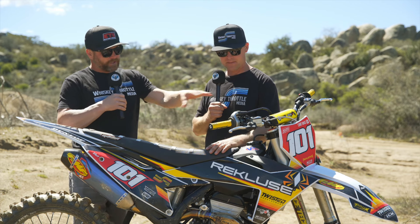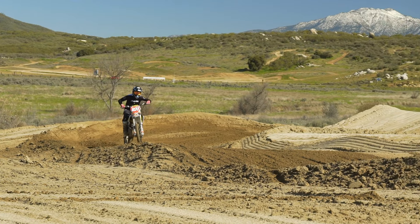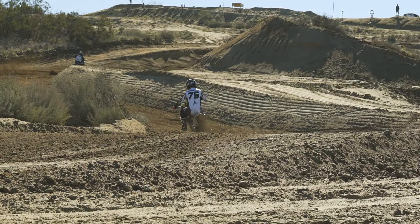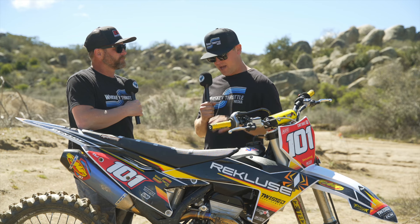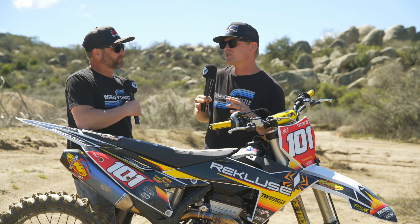The ODI lock-on grips — you can't go wrong with those. The foot pegs were a little bigger than OEM ones, so that's always nice to feel more comfortable on your toes. With the track conditions being a little slick, this bike — and I know it has a lot to do with the chassis, being the steel frame — it didn't feel so rigid. I could feel that flex. It really benefited for how the track was today. That could also be the Works Chassis Lab engine hangers — they do give it a softer character. I always notice it in braking bumps and chatter coming into turns; it allows the bike to fall in easier.